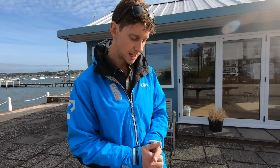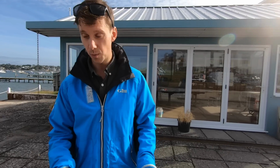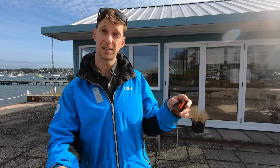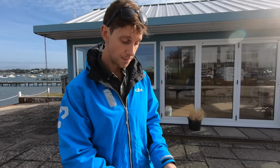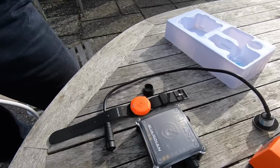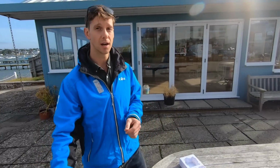Is the engine then cut out for good? No, it's been designed so that it's the contact with water, the water breaking the signal. So once this goes up to 4 inches below the water, that cuts the signal, and within the default of 2 seconds, we realise it's about 1.5 seconds, the engine's cut out. That will cut out, it's triggered for 5 seconds. So after that 5 seconds, anyone remaining on the boat can then restart the engine.